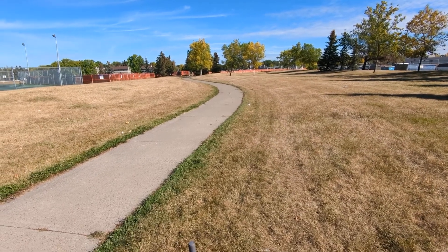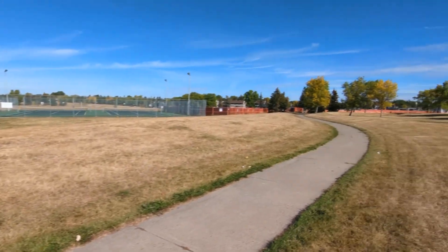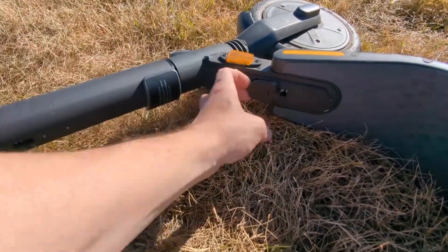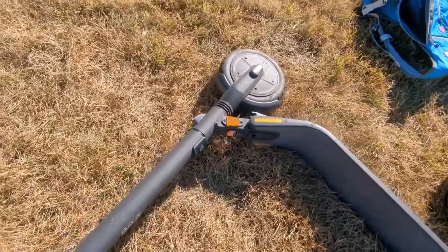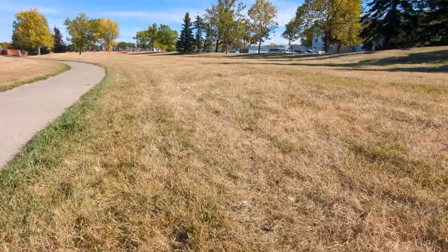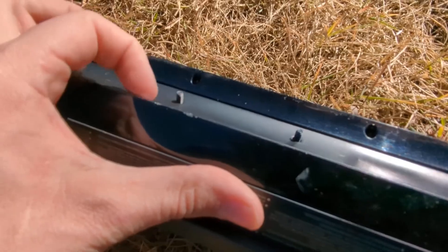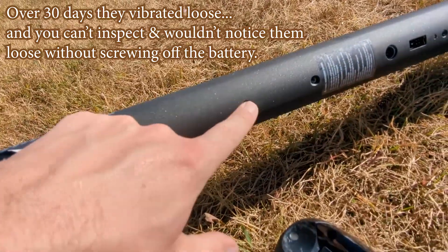Holy crap, am I happy I didn't upload that first part of the video yet. Here is a warning. I was cruising along this shared use path and suddenly look what is not on my Ninebot — it fell off. Everything was fine, and then suddenly this falls and hits the latch — which is my fault, I should have had that up while driving — and it hit it and the handlebar collapses. You lose all steering. I'm so lucky I was just on the main road over there; I would have had nowhere to wipe out. I crashed on the grass and still got a pretty good knock. The screws are still there and haven't stripped — what happened? Well, these things rotate in place. So for goodness sakes, you have to use Loctite thread locker when you put this on because it just vibrated loose.